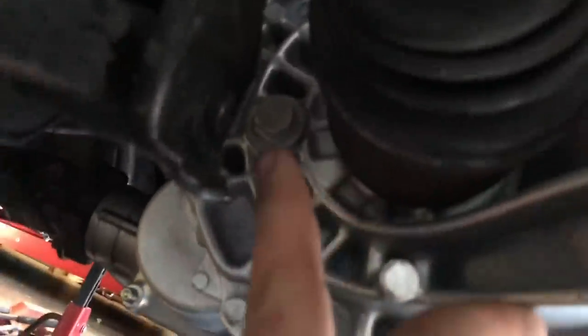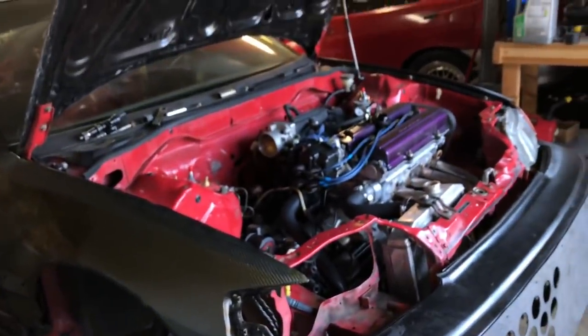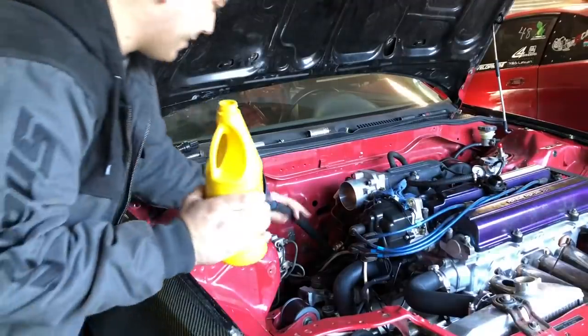That way, you just pour directly into it without any mess, and then to get the right measurement, you either go by the quarts, you can measure it, or if the car is level, then you will open, sorry, everything's shaking right now, this port right by the axle. You open that up, and when it starts dripping out the side is when you have reached the proper level, according to Honda. So I'm gonna start filling that up. I'm gonna put the synchromesh, then I'll put a little bit of engine oil because I mix it together. And that'll be basically the solution that I'm using for this. No real possibility for error on this one.